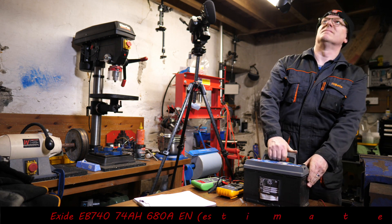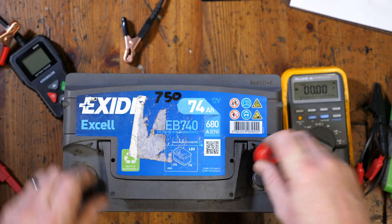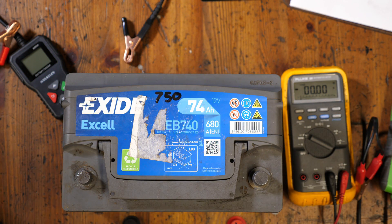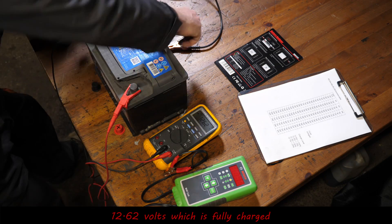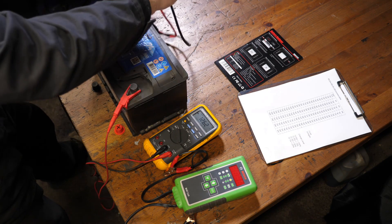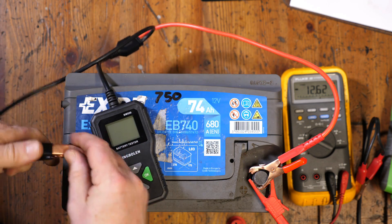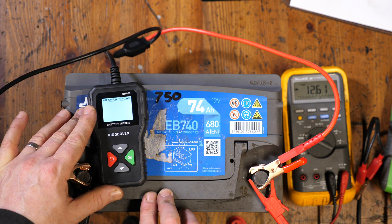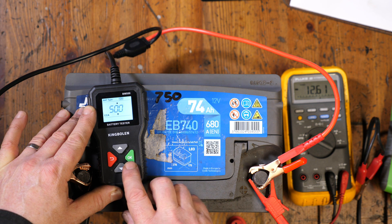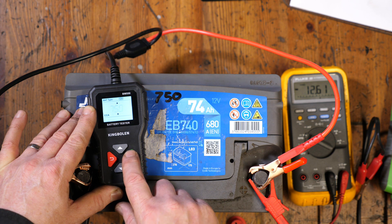We'll try a different battery now — this one is from a Renault Laguna, my wife's car. She changes the batteries even when they're not flat, so this one should actually give quite a good reading. We've got 12.62 volts. I think I actually skipped some of the procedure on this one, so I had to find the screens and add them in. Anyway, we've got 750 CCA on the battery label.